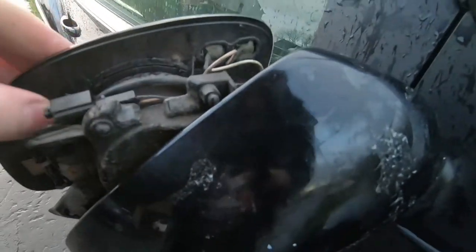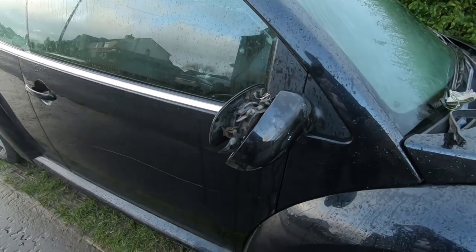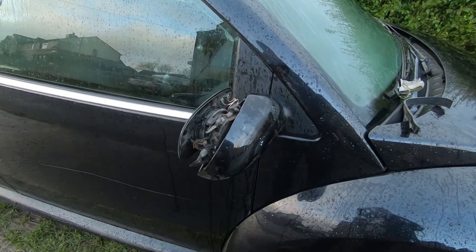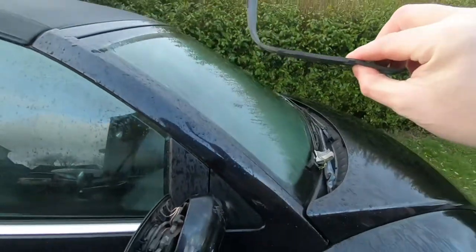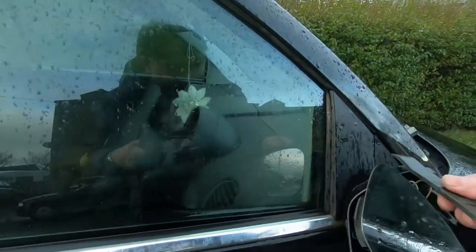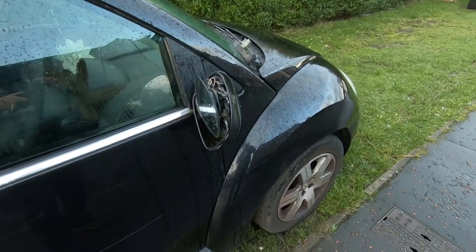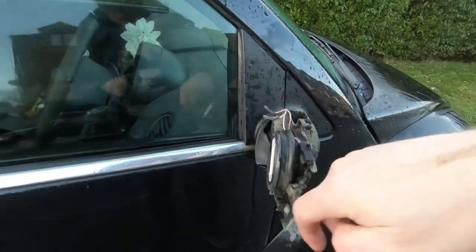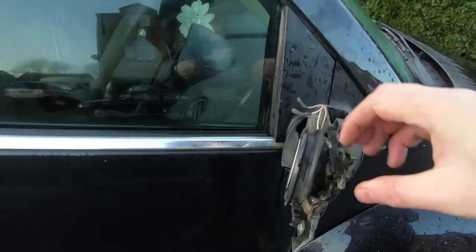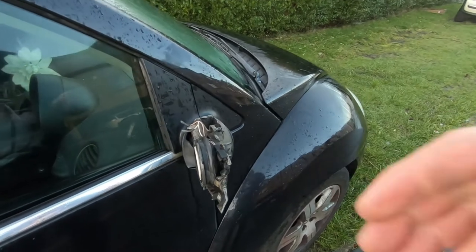I'll do that off camera. I think it's just a few tabs to get that off. I also found this part which is part of the trim - I was looking on a parts diagram I found online. I managed to get the glass off; I had to use picks to push the tabs back. I had to be careful not to end up breaking the tabs. So the glass is off and this bit of the mirror is all right. I'll join in the shed when I try to repair that mirror cover, which should be quite easy to do.